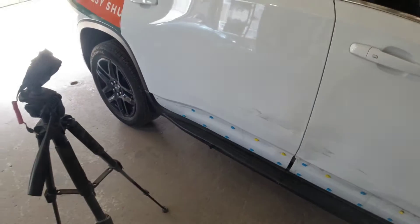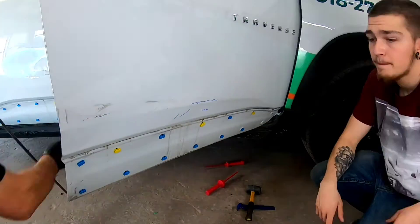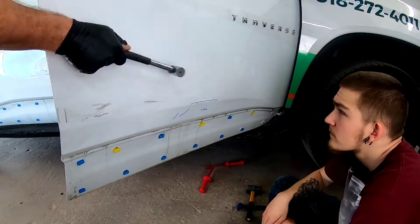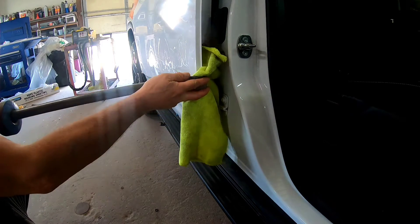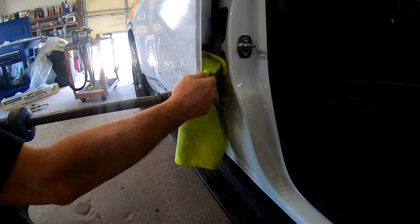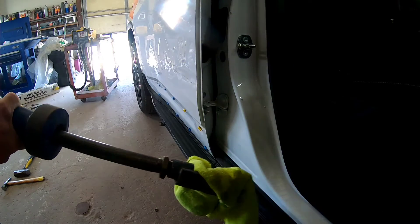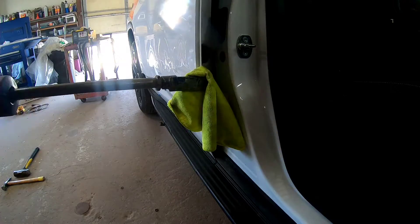I'm going to use this PDR tool — it has a little bit of a sharp edge so we put some tape on it. I'm marking these crowns and I'll use the PDR tool to get leverage on those low areas as Darius and I tap down the crowns and high areas. Now that we've got this front door pretty much into shape, we're going to do some fine tuning. We're going to move on to the back door because this front edge is bent. I've got my slide bar with a towel in between it so I don't damage the paint behind there, and it doesn't really need much of a pull to get it out. There's about a 7 to 8 inch section along this edge that needs to come out just a little bit.